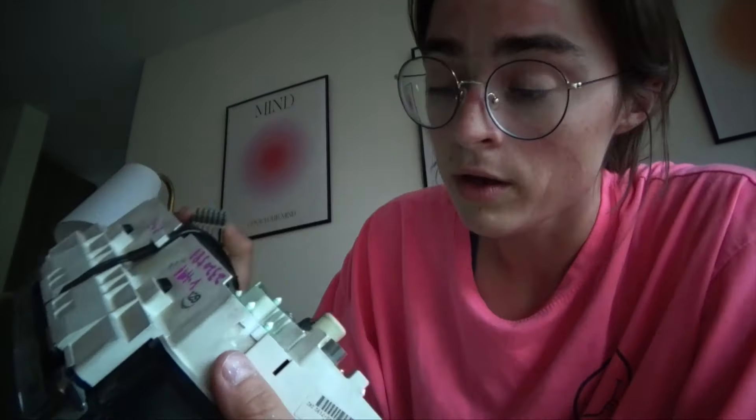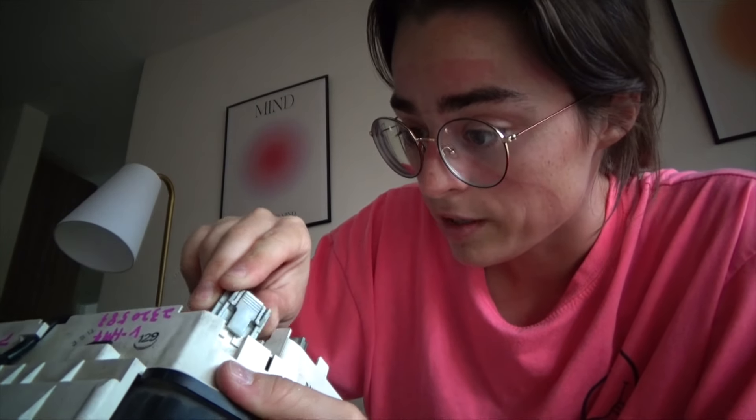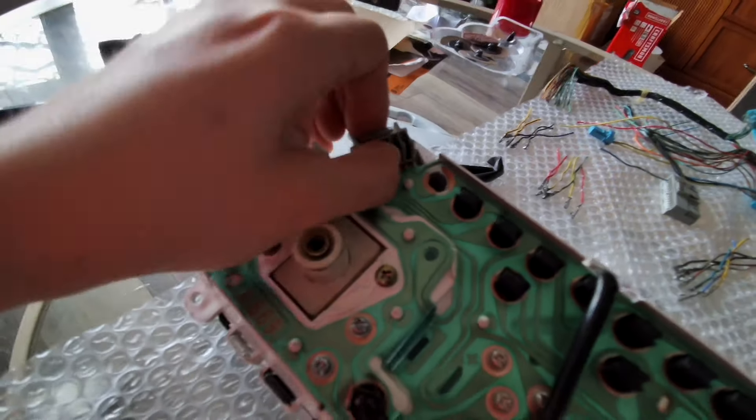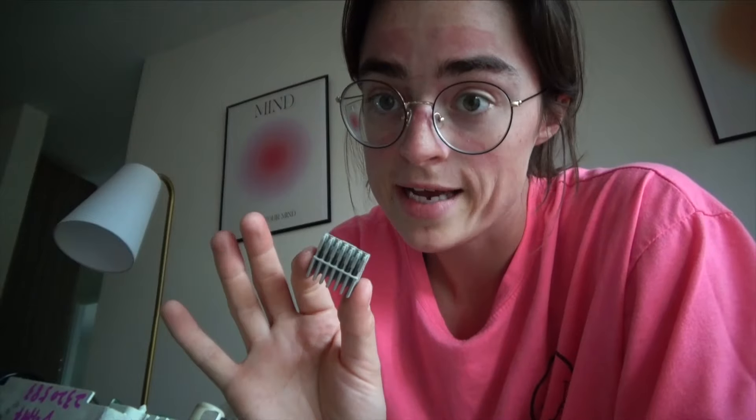I used just a little grinding pad and softened the edges, ground a little bit off. And now my 8-pin converted 6-pin fits into the cluster. That was a little tricky to make sure I got it down to the perfect size, but eventually it got there. Not too bad.